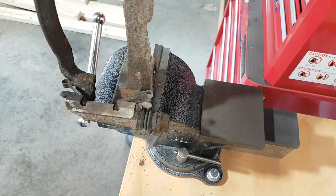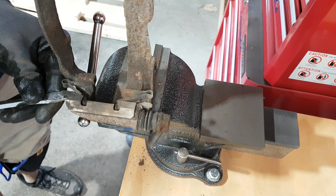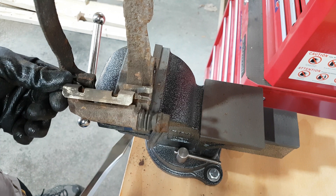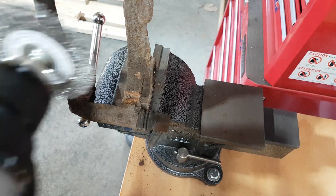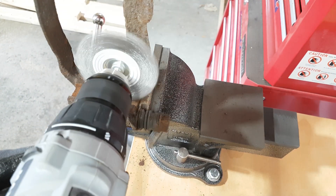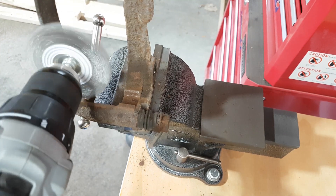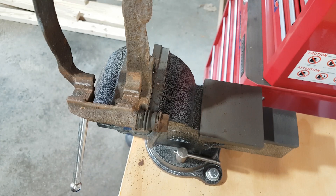For the cleanup part I put the bracket in my bench vise and I'm starting by removing the old stainless steel clips. As you can see, since I live in the rust belt there's a lot of rust in the bracket, and to free up the movement of the brake pads I'm going to have to remove the rust. So I started with a wire brush — I cheated by using one on the drill, but you can use a manual one — and then I used the file to restore the finish.